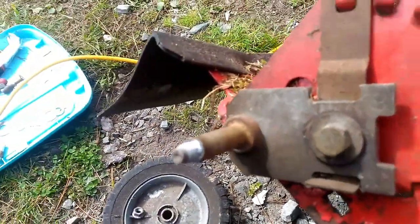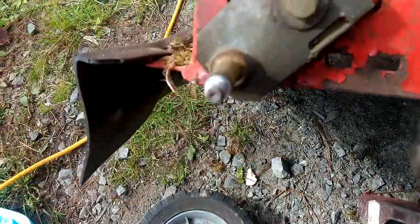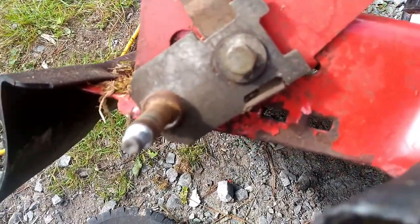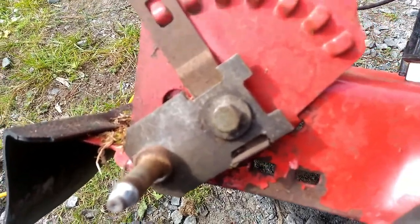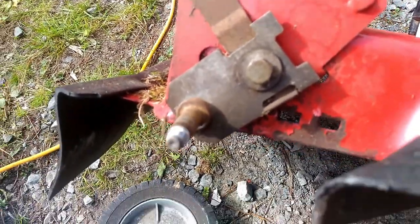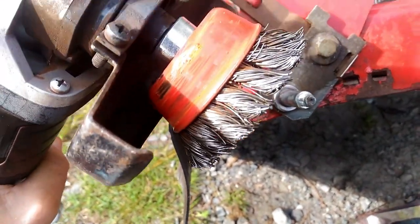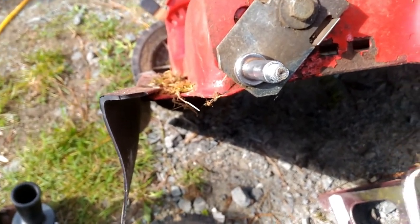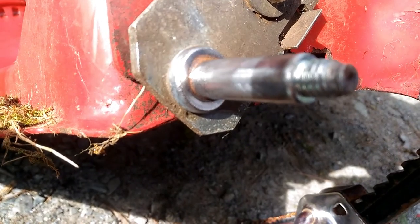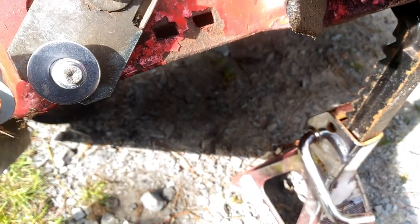You can see that axle — he is pretty darn rusty and full of old crud from the old grease. So I'll grab the angle grinder with the cup brush on there. Using my safety glasses and ear protection, I will clean that up. After about 30 seconds worth of work with the cup brush — that's one of my favorite tools for cleaning things up. I actually leave that brush on that particular angle grinder all the time for cleaning up things for welding or just this kind of thing. This makes a big difference on any axle shaft.